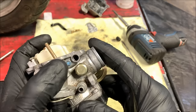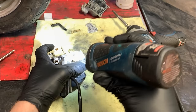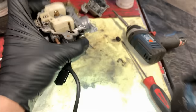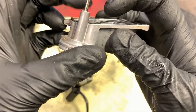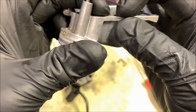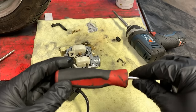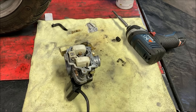Get the spring, washer, and O-ring out of there. This one it looks like they didn't put the O-ring in from the factory — nice quality control there. Once you get a little bit of carb cleaner on the gasket it can be pretty hard to get it back in its groove. What you can do is put a little blob of grease on the bottom to get the rubber to stick back in. Also be aware that carb cleaner will eat the synthetic rubber coating on newer screwdrivers, so put those aside during this next step.